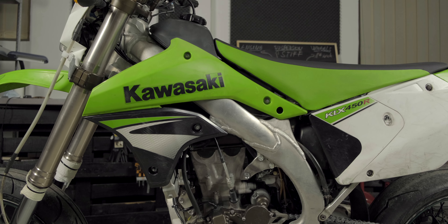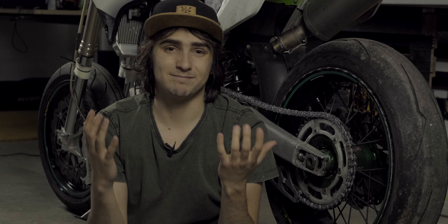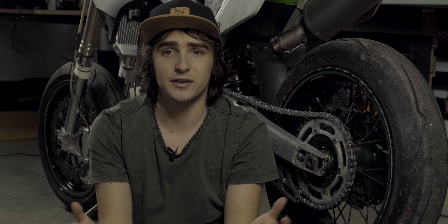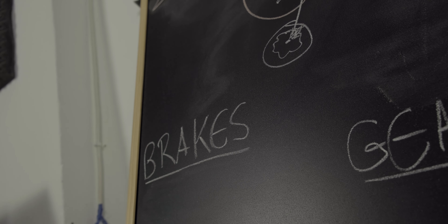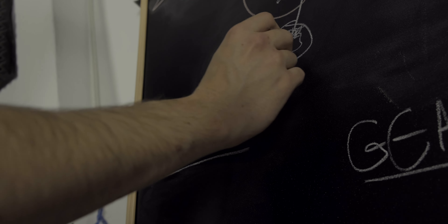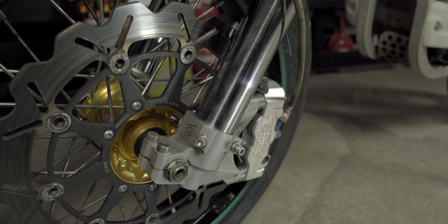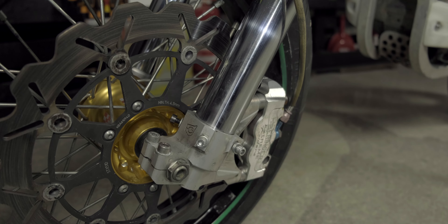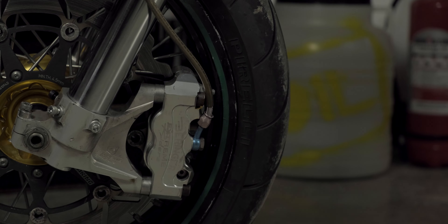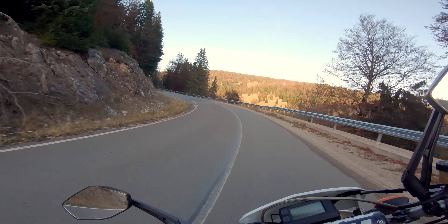Up to here is the bare minimum that a bike needs to have in order to be considered a supermoto, but I would argue that's not quite enough. Yes, you can ride this on the street, but this is not the proper sumo experience everyone is raving about. For that, you're going to have to dive in a bit deeper — and deeper in this case means stepping into the braking system. While the regular brakes are fine for off-road use, they are not designed for repeated stops at high speeds. In order to mitigate this, bigger front discs are a necessity.